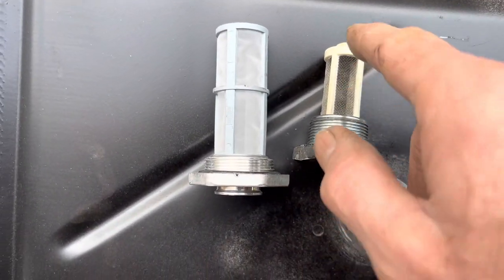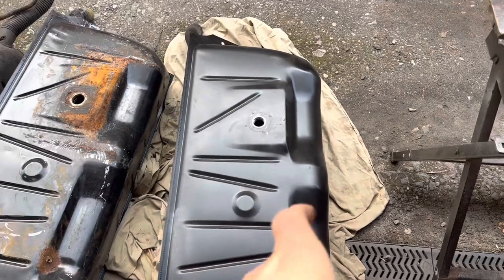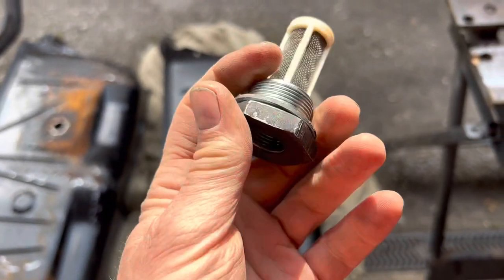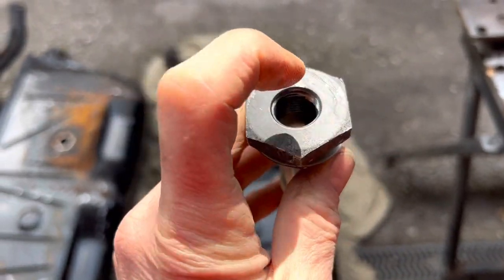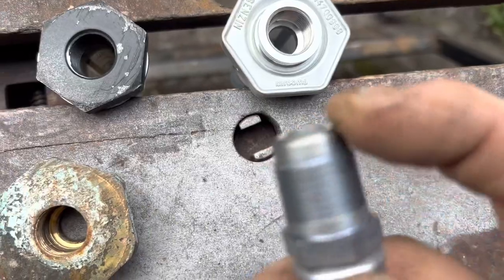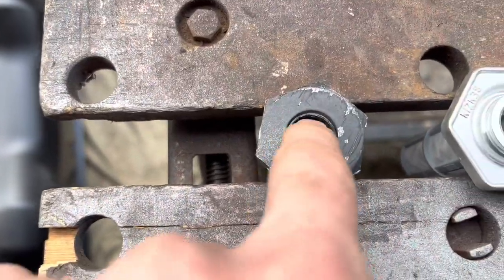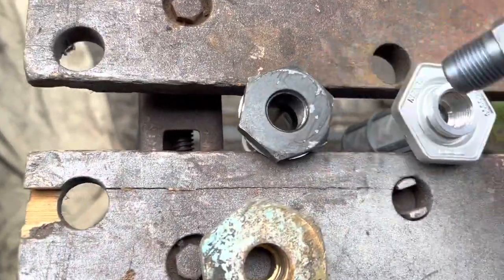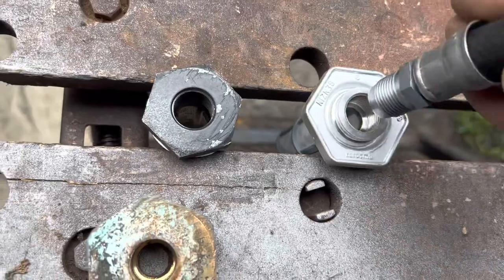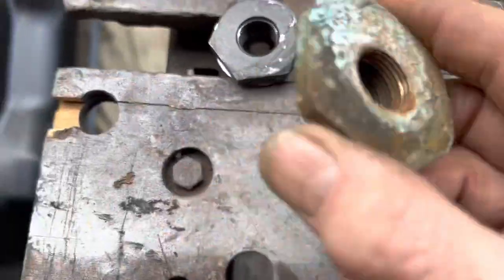That looks like a fuel strainer from a diesel car — it's a much finer mesh. I've seen this style of fuel tank for sale on eBay. There's a company called SJS Car Styling in Germany that sells them, and if anyone has bought a tank like that I would be so interested to know how the fuel pipe seals in there. The standard Mercedes fuel strainer has a seat inside it where the edge of the pipe seals to. The strainer which came with that tank just threads all the way through — you'd be trying to seal it on the edge of the nut, which is not great, whereas on the OEM one it only screws halfway in and seals against the seat inside.